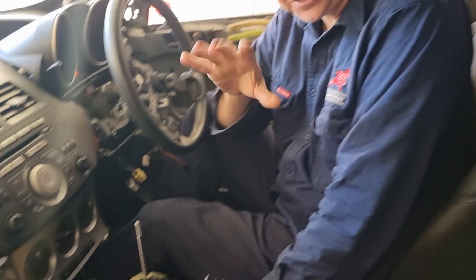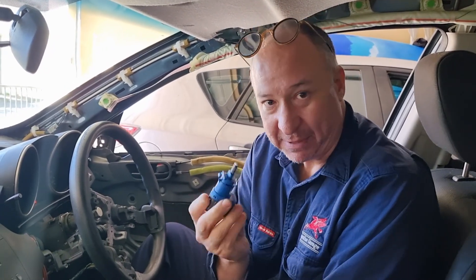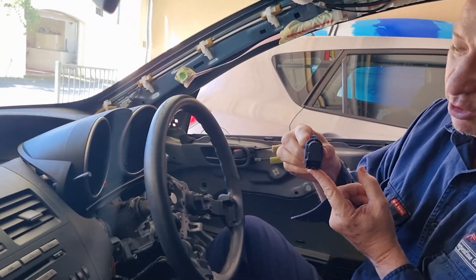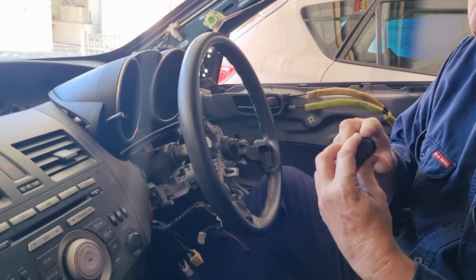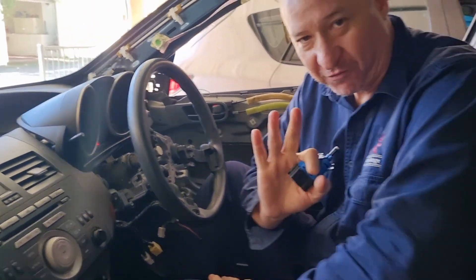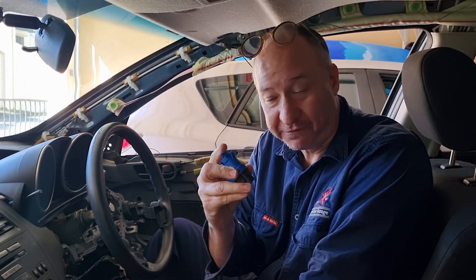I had a subscriber write to me saying they had a faulty solenoid — or at least couldn't get their car out of park even with the battery connected, and thought the solenoid had failed. Two things to check there: it can be the solenoid or it can be the brake switch. The brake switch is easy to remove — you tilt it from the six o'clock position to seven-thirty and pull it out; it's positioned behind the brake pedal. To put the new one in, insert it at seven-thirty, turn to six o'clock and it locks. I've got another video about that linked in the description. So if your park lock solenoid isn't operating, it could be that the car isn't detecting your foot on the brake, or it can be the solenoid itself.